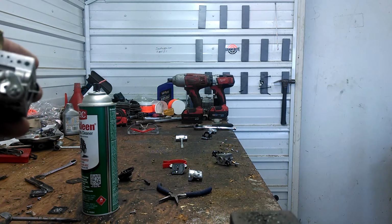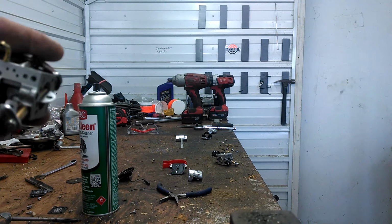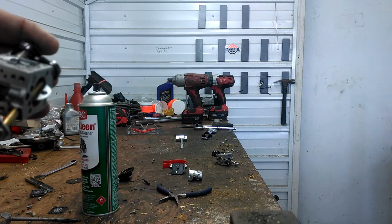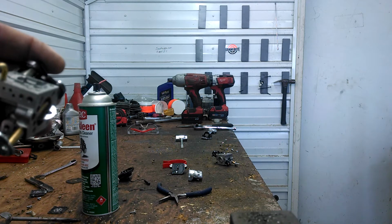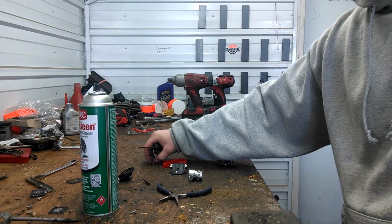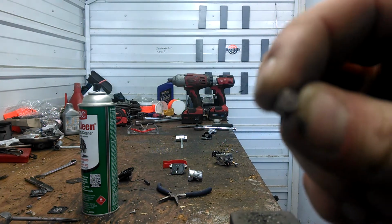I'm just going to run through with the Welch plugs out where the fuel paths are on these auto-tuned carbs. We've been trying to work on a fix for the EL46. The main jet nozzles have the same part number. They are not identical. Physically, the EL44 has an extra orifice on the top. The EL44 has a silver nozzle.